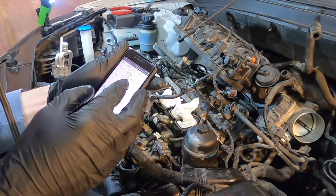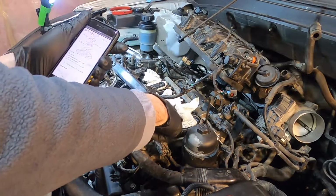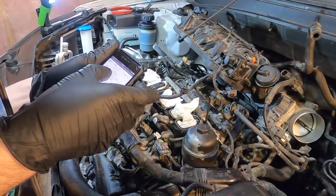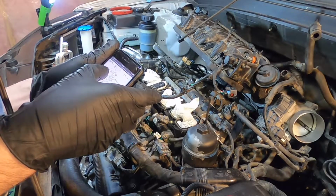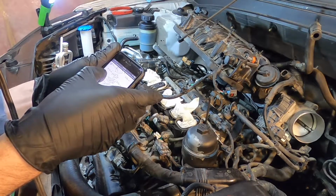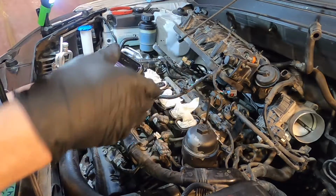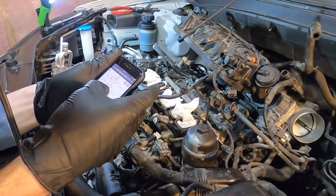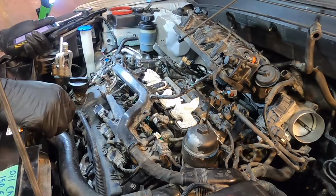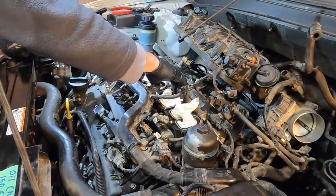And then for the upper intake, this piece where it goes down into the brass there, those Allen keys are 7.23 to 8.68 foot-pounds, and there's also studs on those, so those are going to be 13.7 to 17.4 foot-pounds. I would generally start in the middle and work my way out. That's normally how you torque it up.